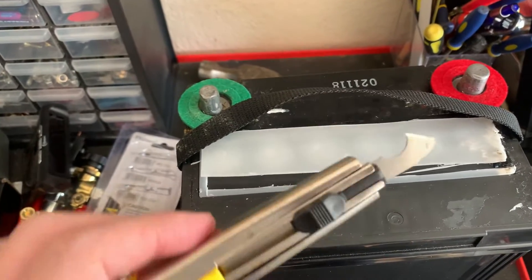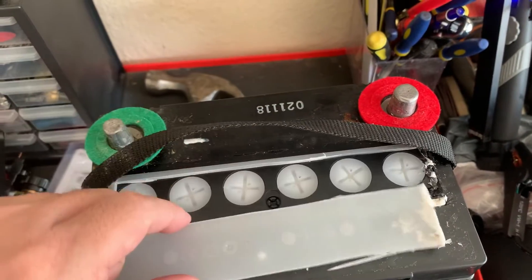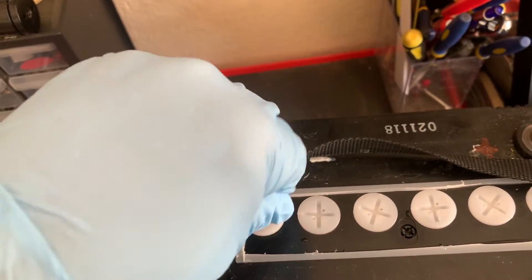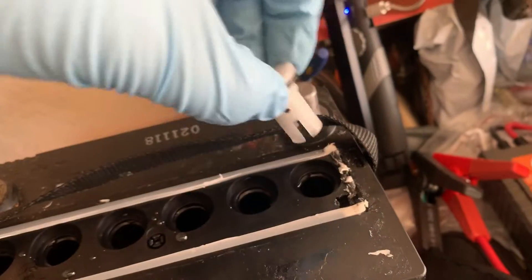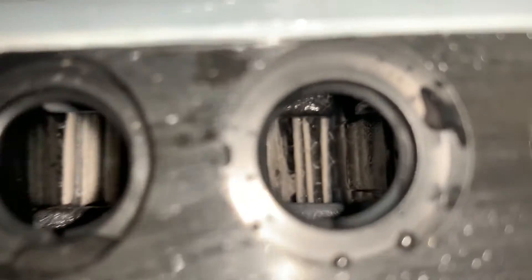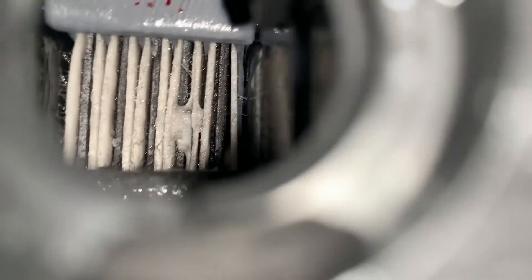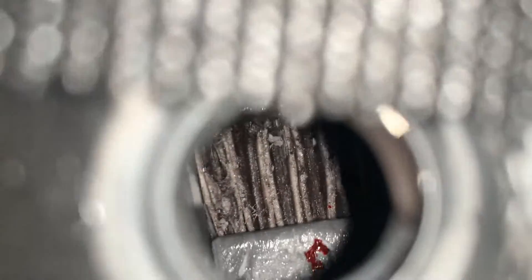Cut off the white panel which is strongly attached to the cover. This would allow us access to the screw plugs which we can open to see the inside of the battery. Looking inside, we see some liquid in there — the electrolytes, which are mostly acid. Note that AGM would have a lot less battery acid than flooded, because the electrolyte or acid are absorbed into the plates. Due to this, acid leaks are less likely on an AGM. Plus, my restoration method might not even work — we'll see.